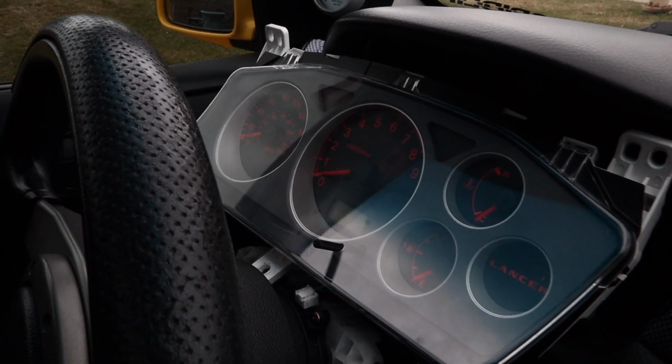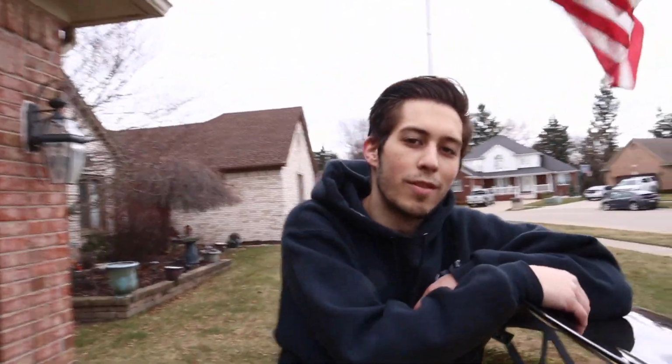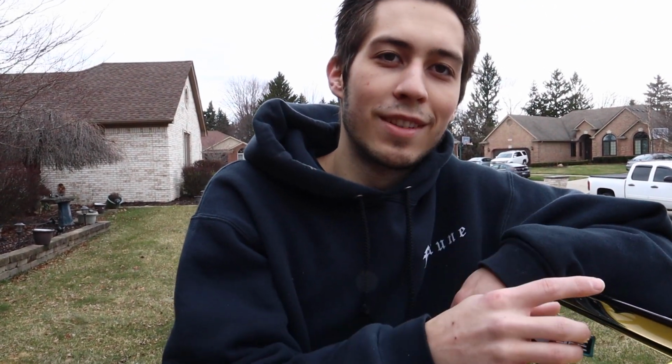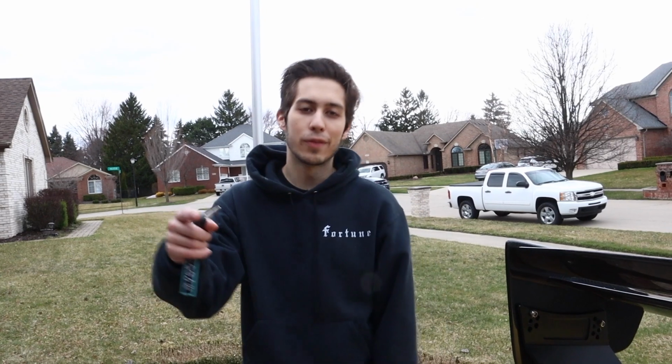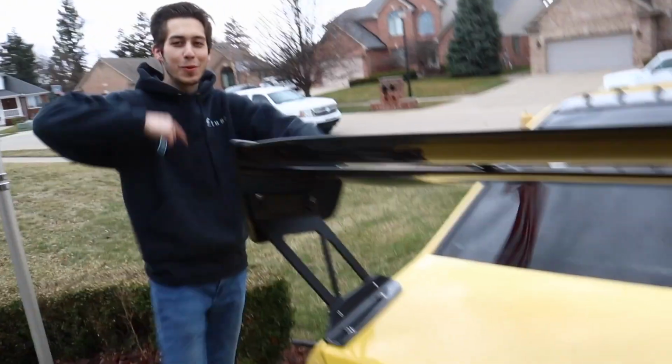Yep, it works. So that RPM actually worked right away. So Justin has some wiring. He got a new harness for the new engine bay harness. So that means he has a wire wrong from the cluster to the ECU somewhere. I get his cluster out because he has to leave early. So let's get that done, and then he can go, and then I can get to work.